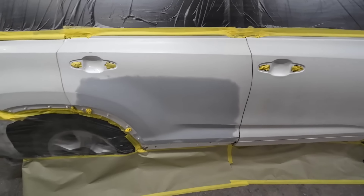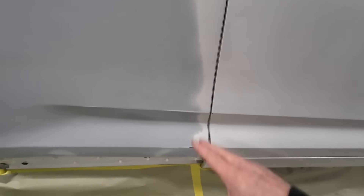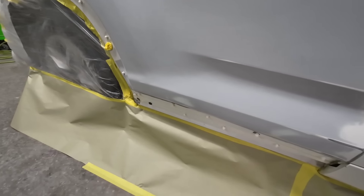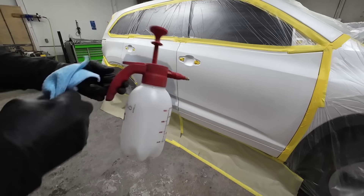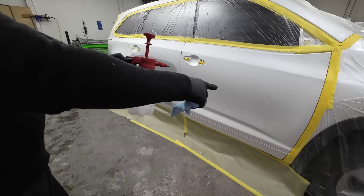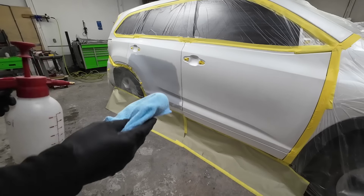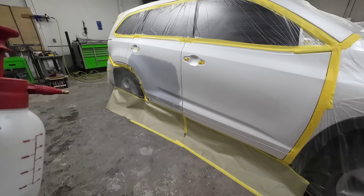I'm going to put some gloves on before I even get near this surface — you always want to wear gloves so you don't contaminate the surface with oils from your fingers. We're going to put our sealer on first over the primer area only. Any areas we've broken through, we're adding sealer. You can see on this edge there's a breakthrough, and here we've broken through into some glazing putty — we're going to cover that with sealer as well. I've got my isopropyl alcohol and a brand new microfiber towel. I'll wash the blending areas first — the door, the top, the quarter panel — and then I'll go over the primer.